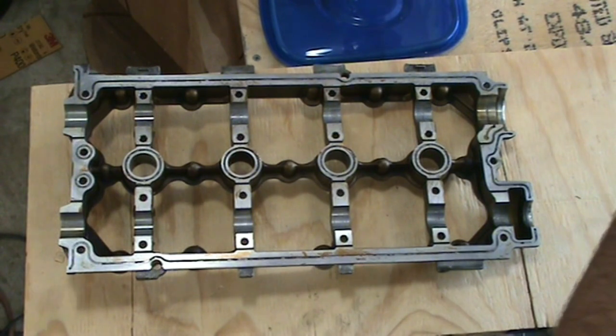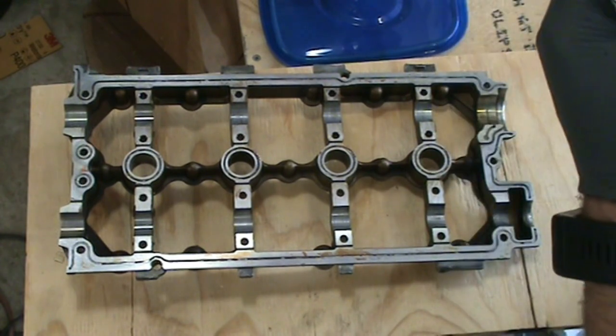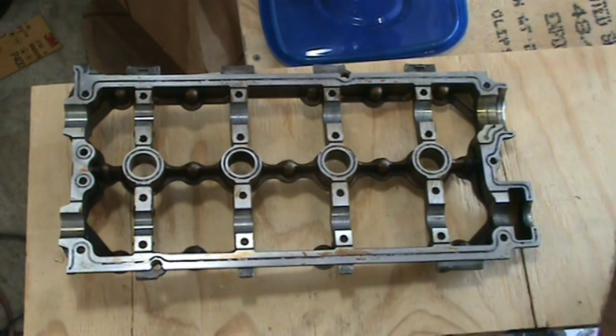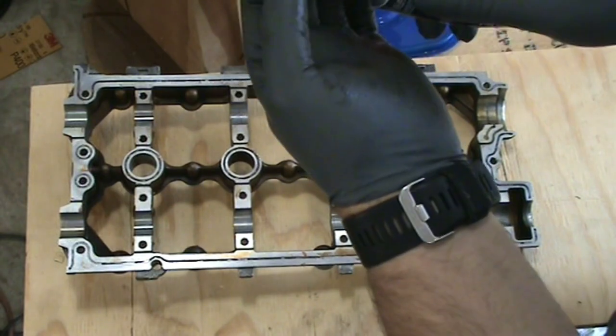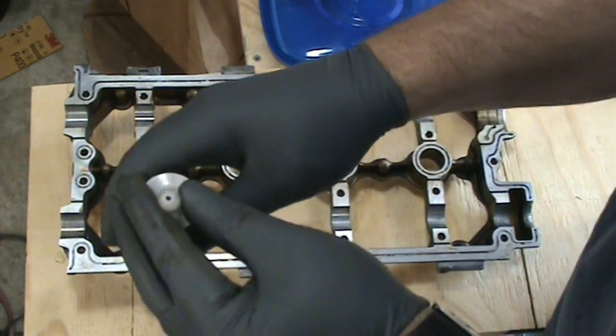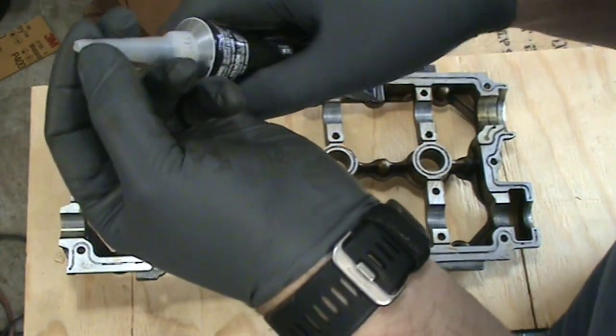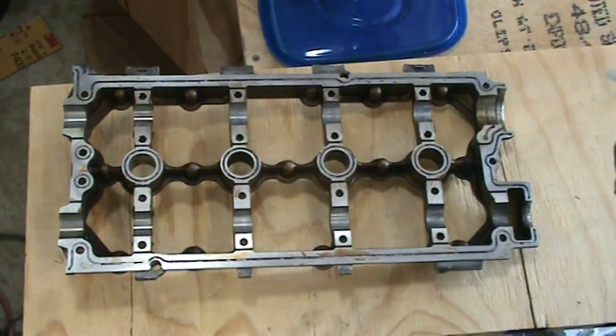In fact, I've had engines that were just horribly dirty, messy, covered in grime. I cleaned them off. The grime was collecting there because oil was leaking out real slow, and then dirt would get attracted to it. And after I've done that, I haven't had any oil collecting on the engine, so it doesn't get dirty, or at least not like it was before. And I always feel like the key to making these gaskets good is trimming this at the appropriate size. So I usually like the hole size on the nozzle to be about that diameter, so right at about the second or the end of the first step here.